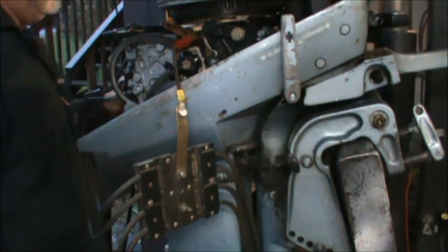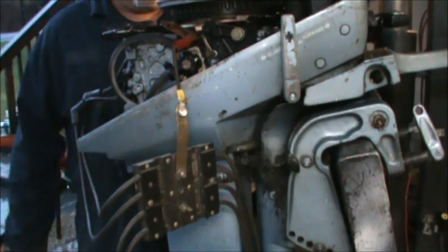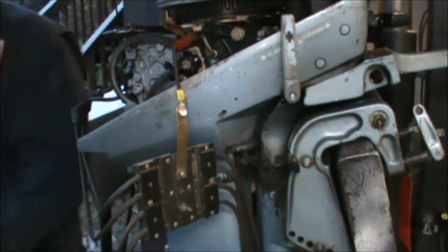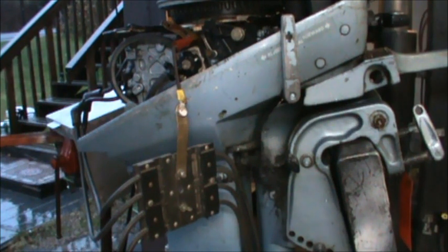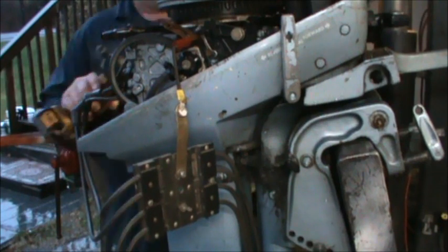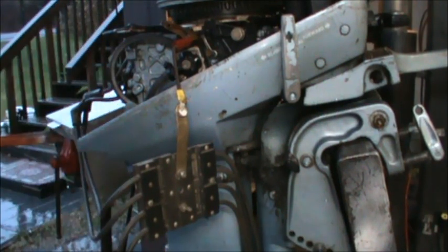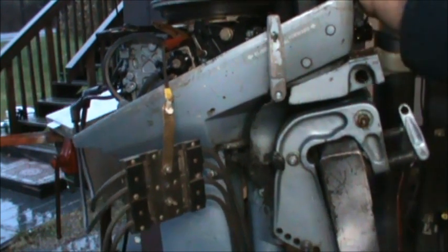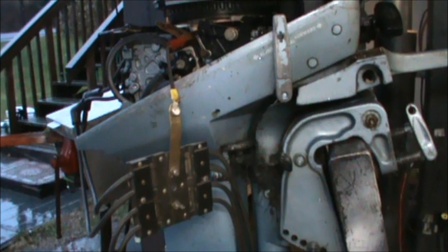So, see if we can trace the kill wire. And the kill switch, come up here, and there's its ground. So let me unhook that ground from the kill switch. See if that does anything. There's my kill wire. I unhooked it. And here, if we get anything. Oh, looky. Apparently, we got a bad kill switch, a grounded kill switch.